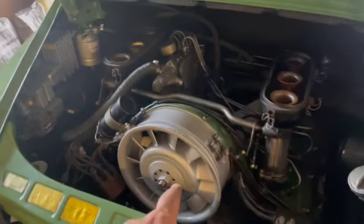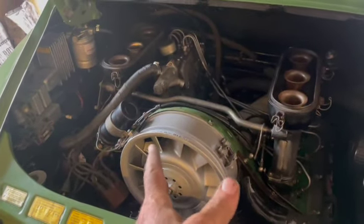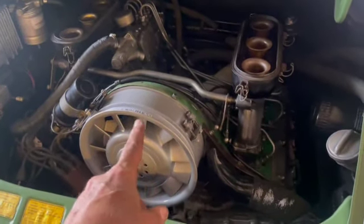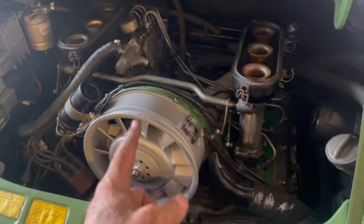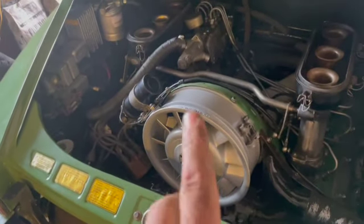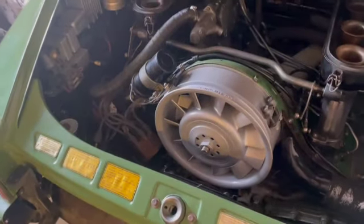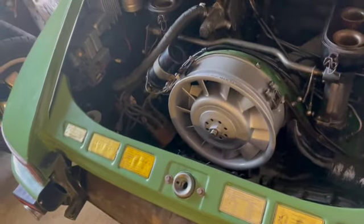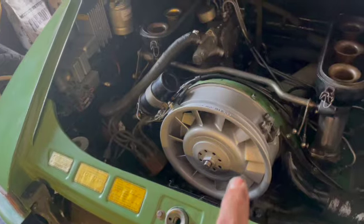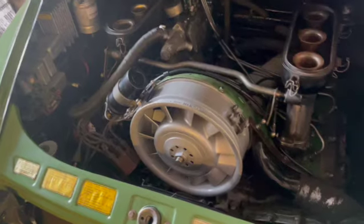Got slowed down a little bit because I looked at a photograph that evidently it appeared to me that I hadn't tightened the primary nut or bolt that holds on the 10 gauge cable that goes on the back of the alternator. I'd had a comparison photo just to make sure I got all my wires in the correct place when I installed the alternator after the rebuild. And I was looking at it closely and I didn't see any threads. So I was assuming that's not tight. But what I had done, I'd put a lock washer on there. So that's why there weren't any threads. So yeah, that took a little time to do.